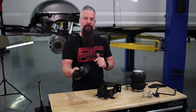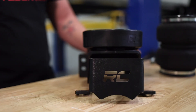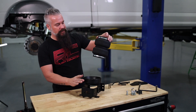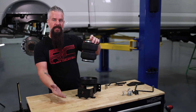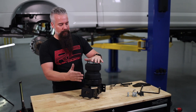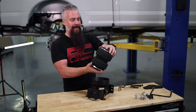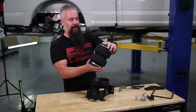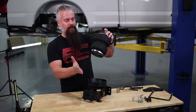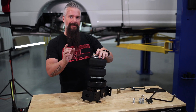We're also going to add Rough Country's air spring cradle. What this does is it mounts on the lower portion and allows our bag to unseat fully so the axle can articulate, drop back into place when needed, and fully air up and work exactly as it's designed. Under some situations, the airbag could actually act kind of like a limiting strap. So we want to go ahead and add this — it's going to make the life of the bag that much longer and the usefulness of the truck that much better.